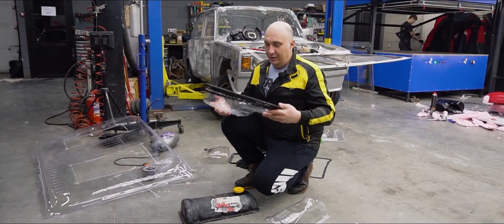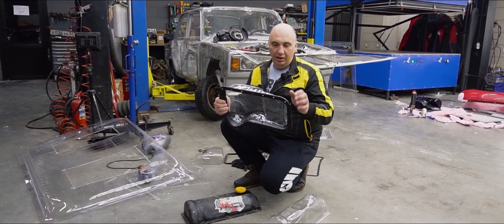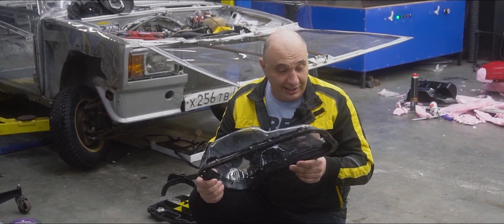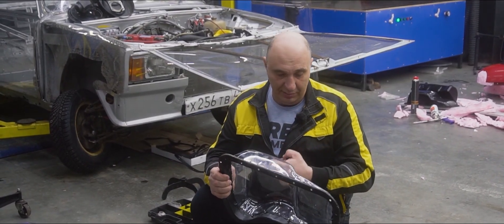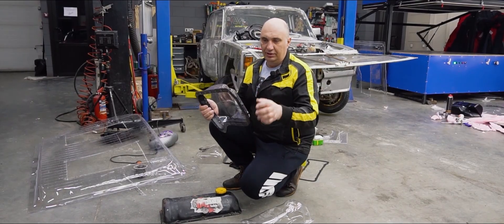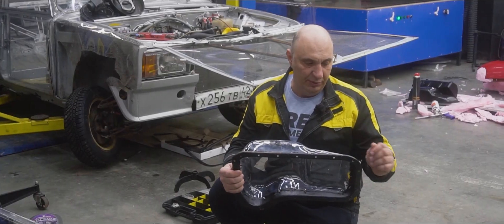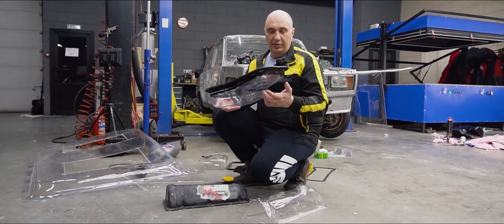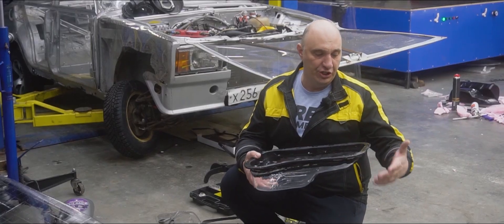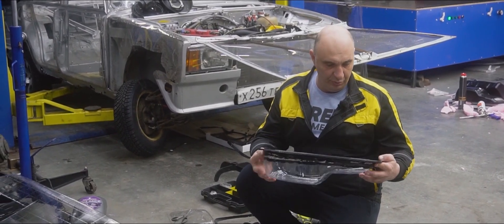Here's what we've made so far. The oil pan — we did get the shape that we were looking for. However, the bit where you've got all of the mounting points was always just a tiny bit off. The plastic's not fit for the task — perhaps we need a slightly thinner material. The thick stuff does work pretty well. So we actually cut out the rim from the factory oil pan and we've got the sealant in there. Plastic is an inherently soft material, and if we were to bolt everything down it might not have formed a tight enough seal and we would have had an oil leak. This way we can be 100% sure there won't be any problems.